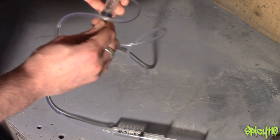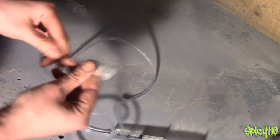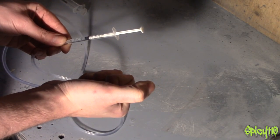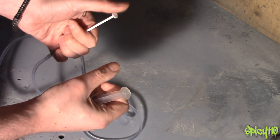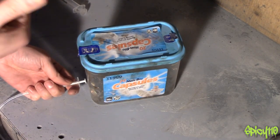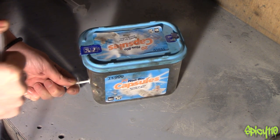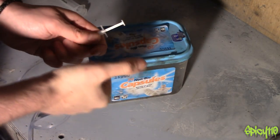However, if we take off this big one and get a very small one — keeping in mind this is a 10ml and this is 1ml — a very small press on the big one has a big effect on the little one, but it's difficult, it feels hard. On the small one it's very easy to press but you only get a small movement out the other side. That small movement is again very powerful, and this is the basis of how brakes kind of work.